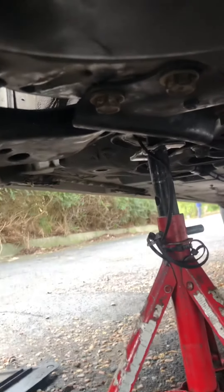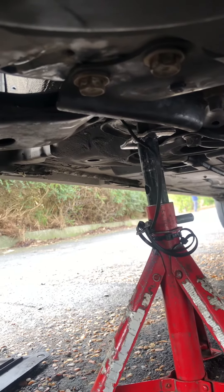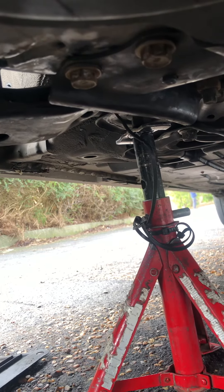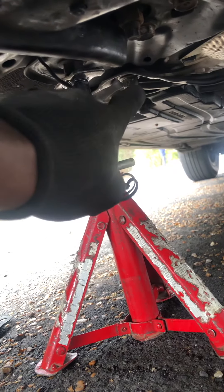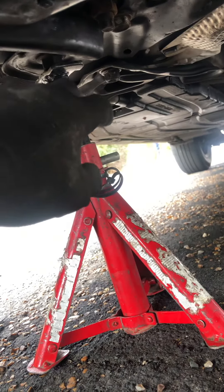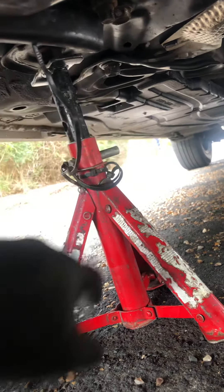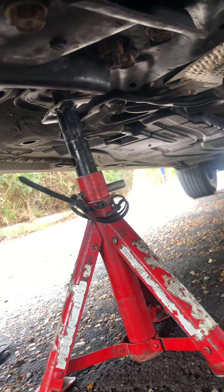If you like my video, please subscribe to my channel. To summarize: this was about suspension noise on the Toyota Prius. The three screws holding the triangular metal plate between the chassis and the subframe tend to come loose over time and need to be tightened up — after doing that, the noise should stop. Thank you.